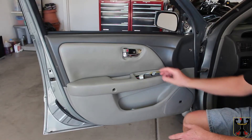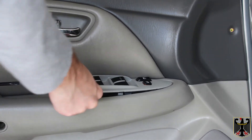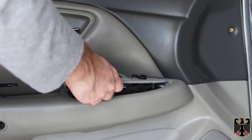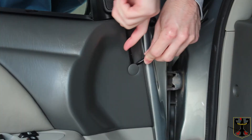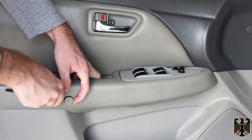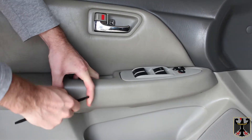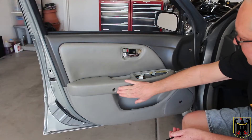To get the door panel loose you're going to have to take the window control assembly out and unplug it, and then take a screw for this bezel piece and take it off. There are a couple of pop-out type clips. There's a screw that goes in here so you take the little mushroom clip out. You're going to use some pry tools to get it out so you don't damage the plastic.